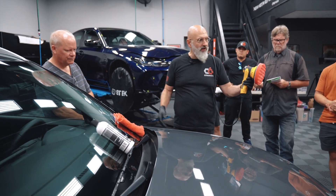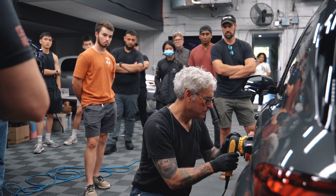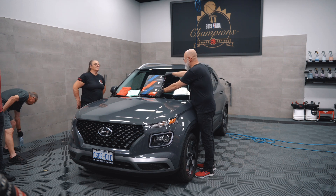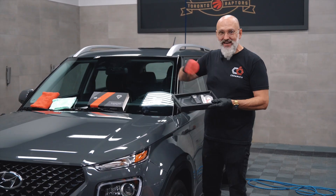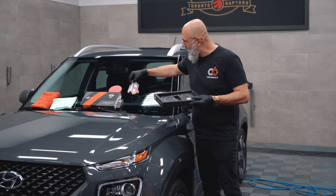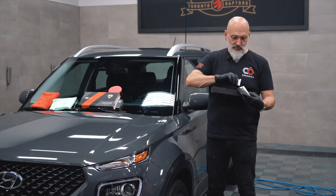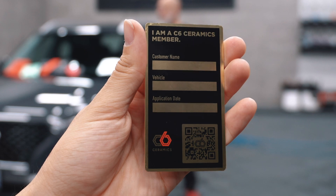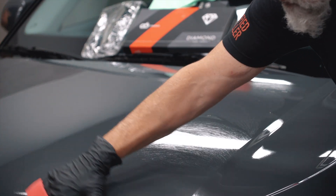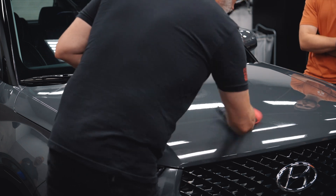If anybody would like to carry on — first step, C6 adhesion promoter polish application. We're going to be putting diamond on this one. What you get in the box is an applicator, the bottle of diamond gloss, a big sticker you can give to the customer or put on your toolbox, and a clear sticker that goes in the door jamb to indicate there's C6 on the car. On the professional ones, we also have a nice gold card you can give to the customer with their name. We don't want a thick layer of coating — thick is not a good idea. So I'm going to spread it out as far as I can, covering at least half the hood. I'll add two drops on the applicator since it's already primed, then box in and fill in a circular motion.